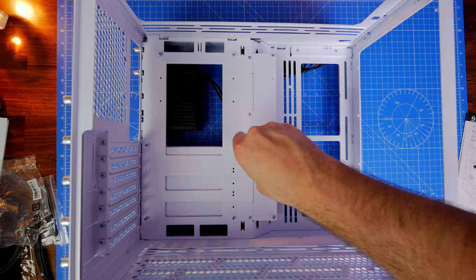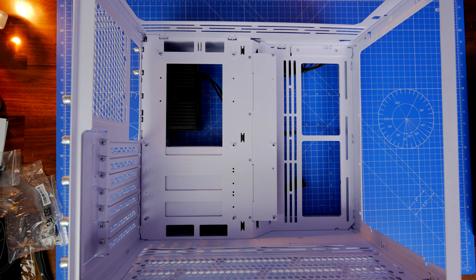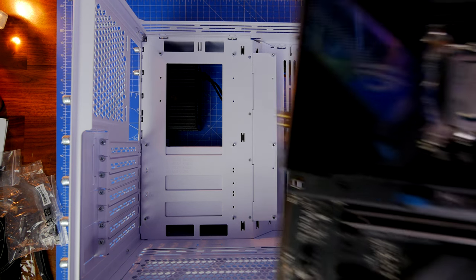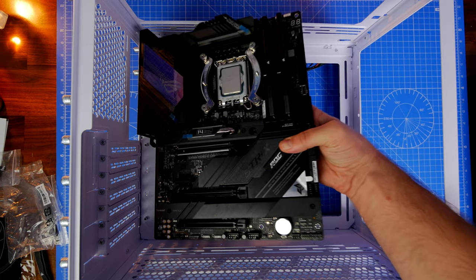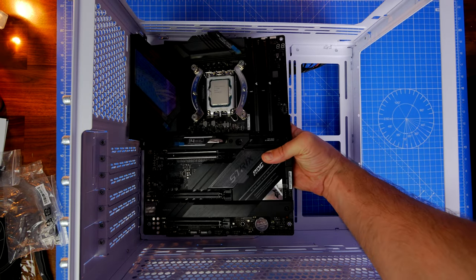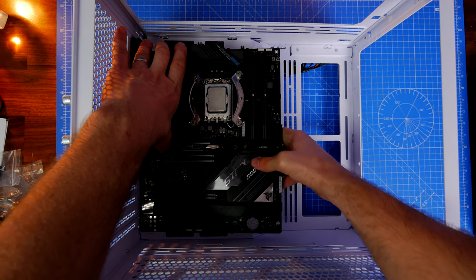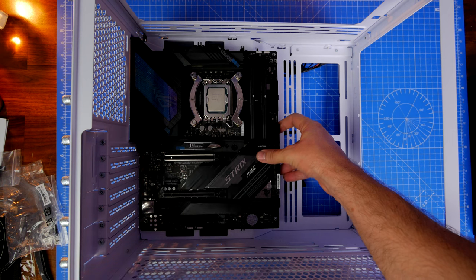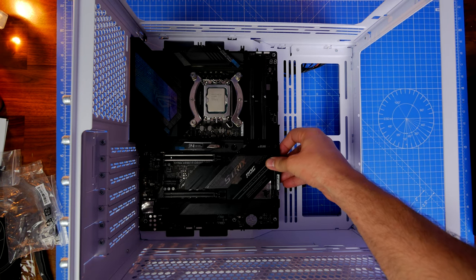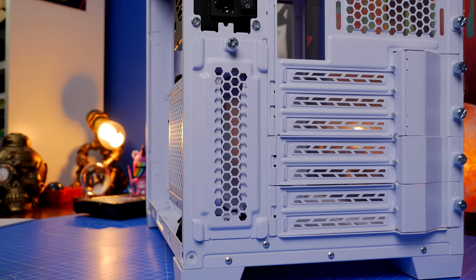There are some complexities to this process which I'll go into in more depth in a little while. For example, the installation of the fans — my tip now is to get the motherboard in as soon as possible. You'll see why a bit later on. I made the mistake of leaving the motherboard till nearly the last point, and because it's an ATX motherboard it takes up quite a bit of room in the case.